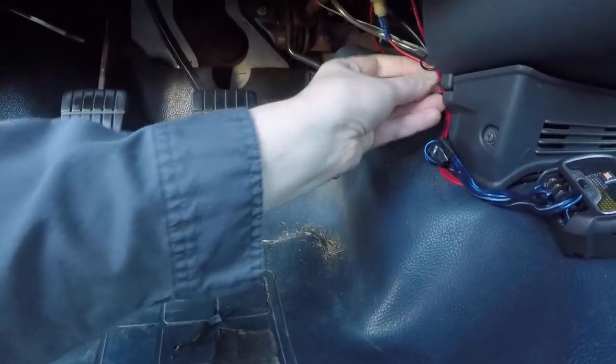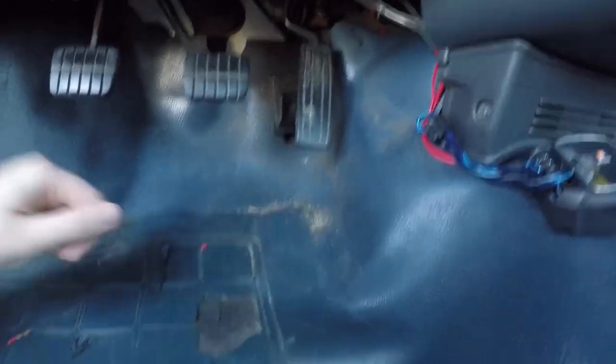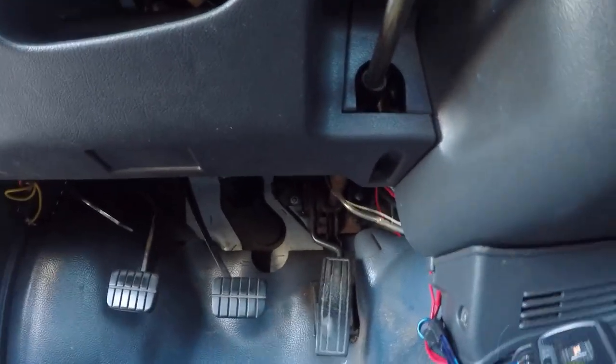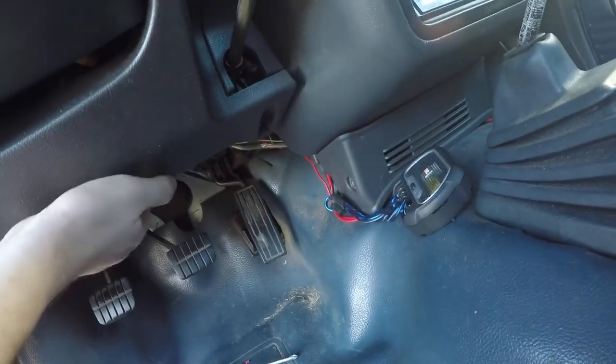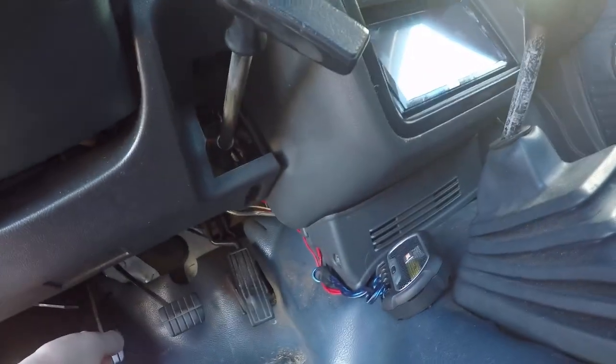Could do better work on my wiring jobs, but hey it works — I might zip-tie that out of the way. Anyhow, back to the actual dash part. You need to pull that instrument cluster out, so it's two screws for the first part — a Phillips head there and a Phillips head right there. Once the screws are out just kind of pull back a little bit and it'll pop off. You'll also need to pull a little cap off for the e-brake.